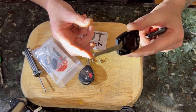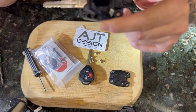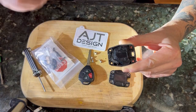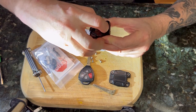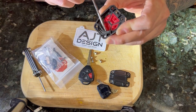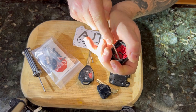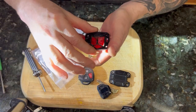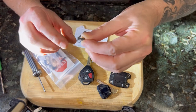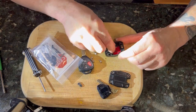You always want to open it with the front side facing down. This is actually the money shot right there — this was the main reason why I'm doing the video. You're literally bringing it down to your original key. The piece we're actually trying to extract with the dremel is this guy, which is an immobilizer of sorts. This guy will give a handshake with your immobilizer in the car, confirming that it is indeed an authorized key. This is basically what we're going to extract. All in all, it's not that complicated.